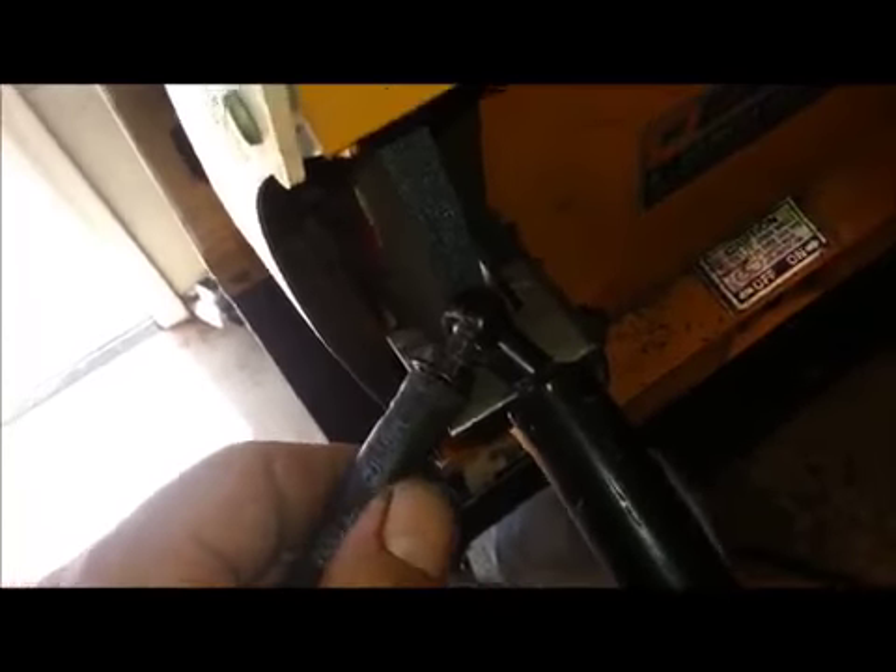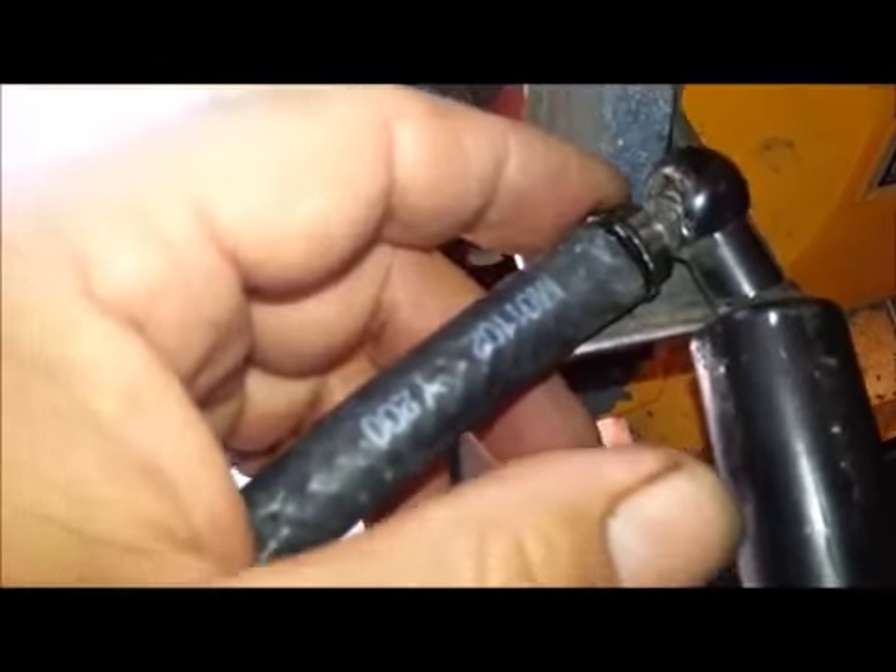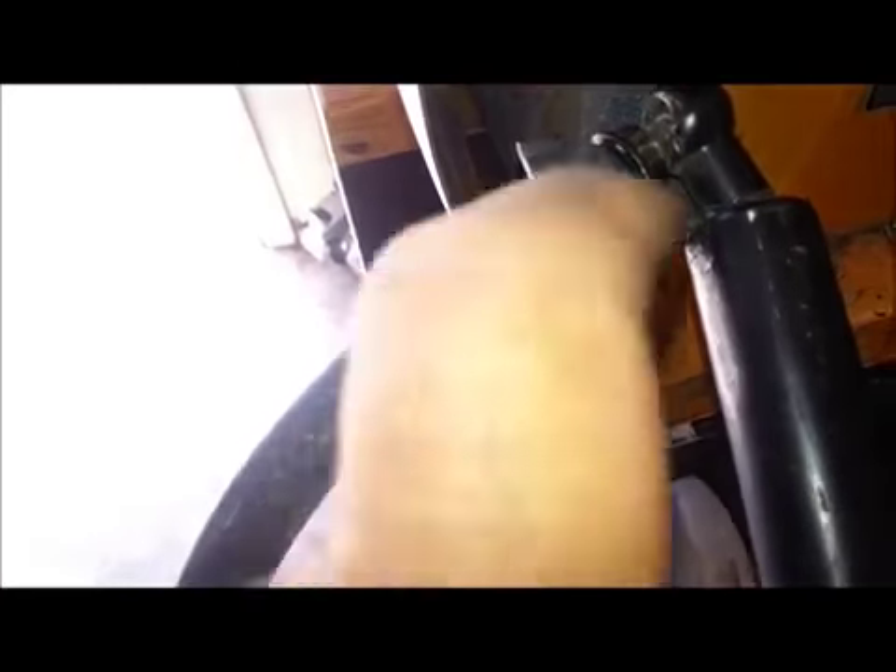There's my hose, and I'm going to use that with my left hand to keep the stud from hitting the grinding wheel and ruining it. You've got to be real careful about grinding here — you're going to do that in about a half semi-circle, and then you should be able to pry it apart. I'm hoping it doesn't break off and become really difficult to remove. I'm going to use both hands and get in the grinder. Remember to wear safety equipment.